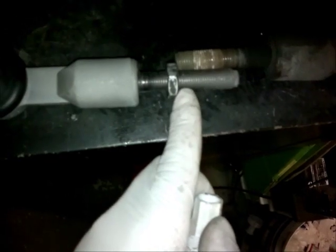There you are - that's my new track rod end. And that's the old one. These didn't come with new nuts, so what I've done is put it in that position on the original, lined them up like that, got my Tippex and marked it just before the nut, and I'm winding it on up to there.